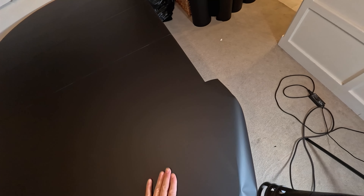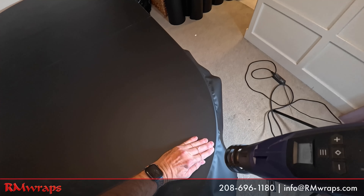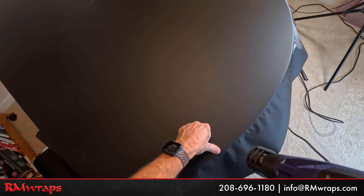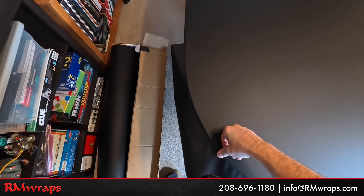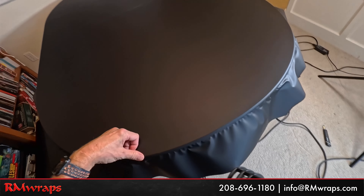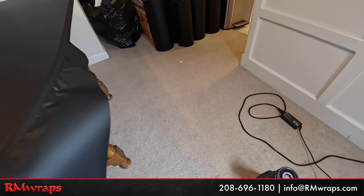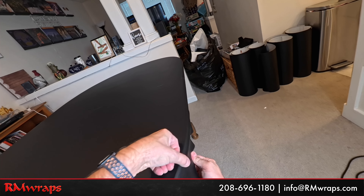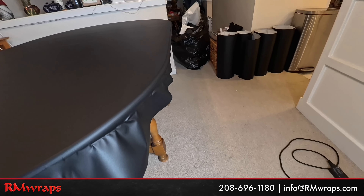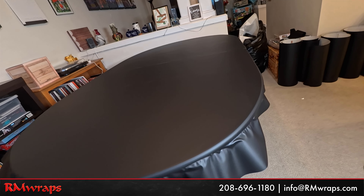The less heat, the better. Right now I'm using the heat just to soften up the vinyl a little bit - I'm not stretching it or anything, barely putting the heat on there, just enough for it to start what I call dancing. I'm taking my thumb and gently putting the vinyl down, feeling the vinyl around these edges, making sure there are no bubbles or creases. I'm slowly going in around the edge of that unit. Usually around corners like that it does have little creases and it doesn't go down as easily as the straight parts.